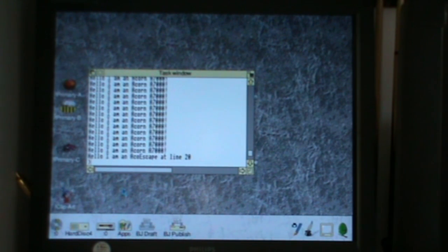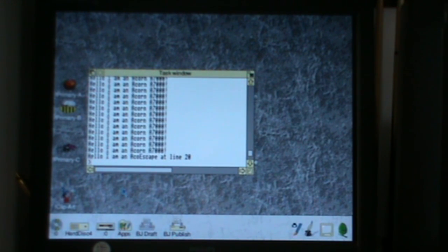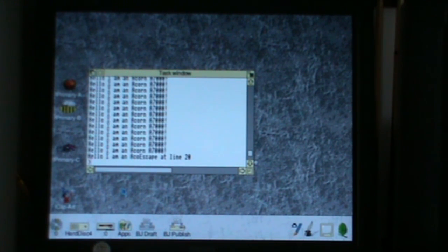So there we go. There is a quick overview, hopefully not too boring, of the Acorn A7000, the last in the Acorn line. But it's not the last thing designed on the processor. Of course, probably the smartphone that you're using nowadays is based off a processor descendant of the one in this machine, especially the very fact that this machine has the second chip that started to integrate the video display unit and the I/O control unit all in the one chip, which is what has allowed the miniaturization that allows our phones to work with pretty much a system on a chip.